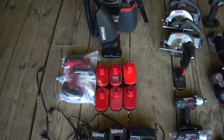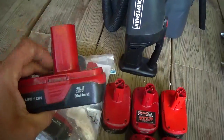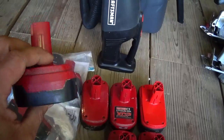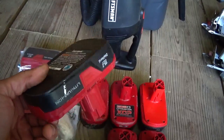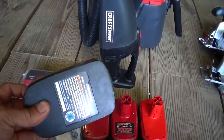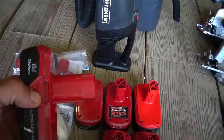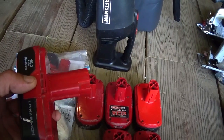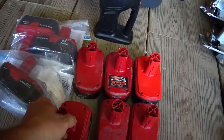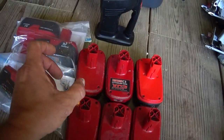Another thing too is, later on down the road, if we struggle with trying to replace our batteries and you still have a handful of tools you want new batteries for, you could probably easily buy the Ryobi batteries, which will probably be around longer. You could very easily just take your circuit board off, put it on their battery pack, and it would all fit down inside this case. So you could rebuild the batteries easily, or you could even take a battery apart and take individual cells out.